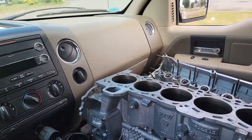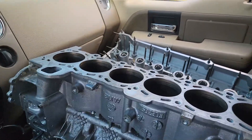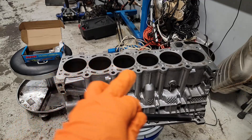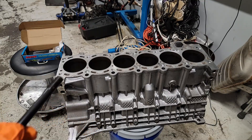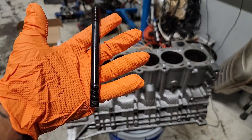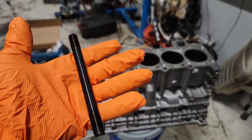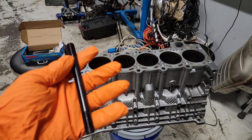I'm gonna take this to my shop tonight and put those head studs in just so they're in there - I want to see what it looks like and have that satisfaction of finally having them in. Back at the shop now, I've got my ARP head studs. I just used some brake cleaner to get the metal chips out of the drill holes and I'm going to install these. I'm not going to torque them down because they need lubricant to replicate the torque specifications ARP gives. I'm just putting them in for satisfaction, to take a picture and show the comparison between the M10 bolts and the M12 head studs.